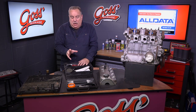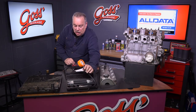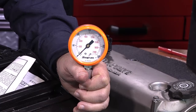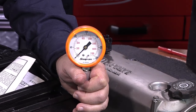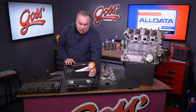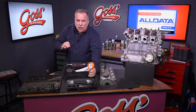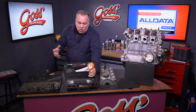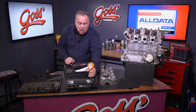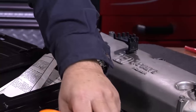A lot of people seem to think that using a compression gauge is going to be the answer to determining engine condition, when in reality it may not be. We don't use compression testing that much anymore, unless we have a dead cylinder — a cylinder that just plain isn't firing — and we want to find out which one it is and we can't do it electronically. So lots of times we use compression to find the dead cylinder.